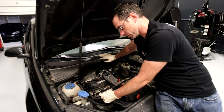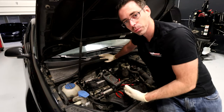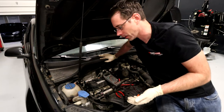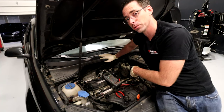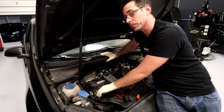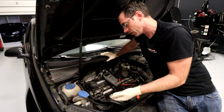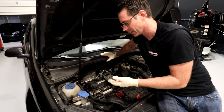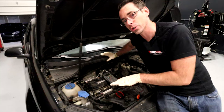The last part of the wiring check is pin 2 — this valve is grounded through the ECM. I'm not going to check it here because the output test already confirmed it works. If you wanted to test it, you'd need a wiring diagram to find the correct ECM pin, remove the cowling and connector, and do a resistance test between pin 2 and the associated ECM terminal — just verifying the wiring is good. Since the valve actuated, we know wiring is fine. We'll reinstall and do one final test.